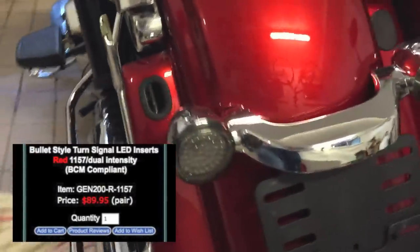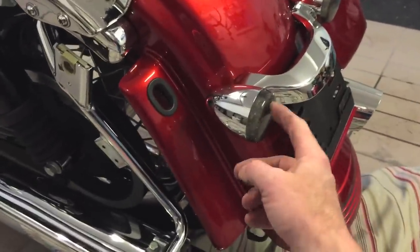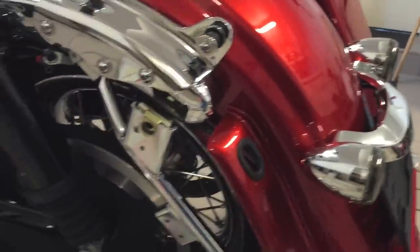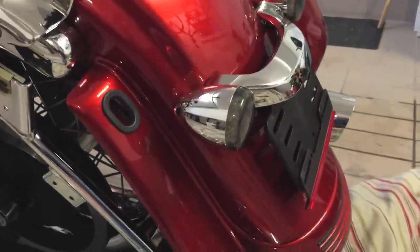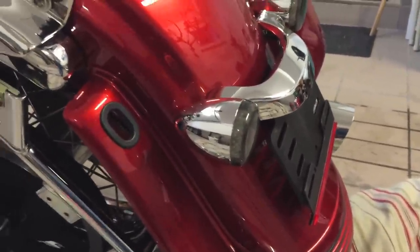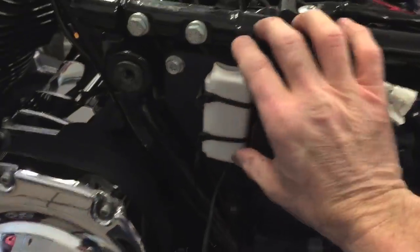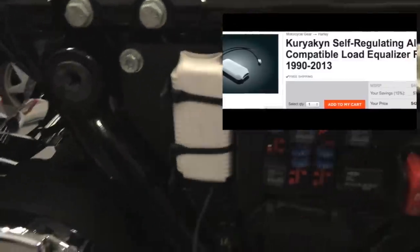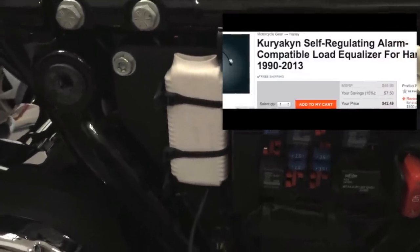All I could come up with was the fact that I have LED lights on the rear already. These are inserts that go in, but they have a little pigtail off of this LED disc that goes into the normal socket and twists in just like you would with a normal tail light hole. The piece that prevents them from flashing rapidly — because the LEDs are a different electrical load and therefore flash super rapid — is this other component called a load leveler. It's from this pigtail to the white component here, and it allows the blinkers to go to normal flash rate with the LEDs.